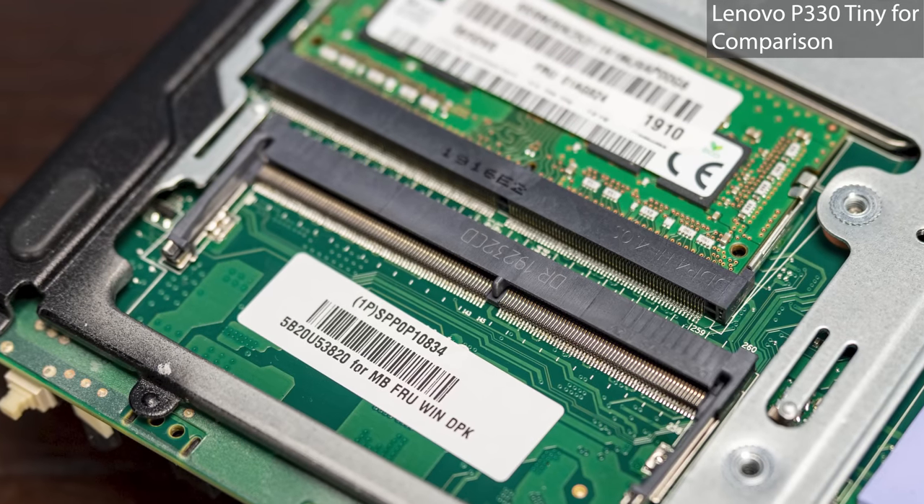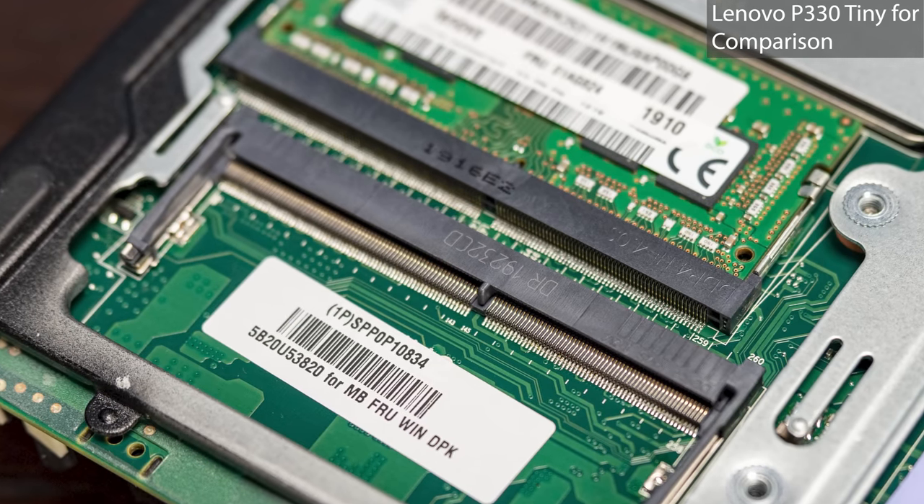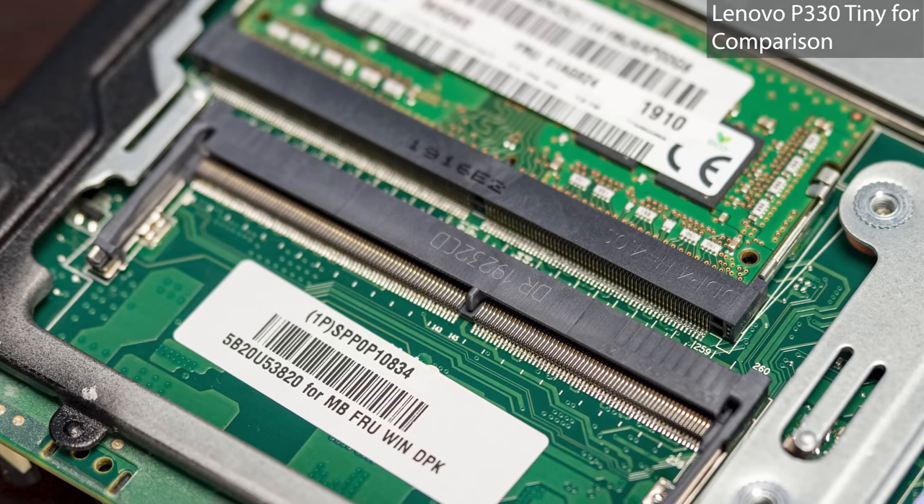While that side of the internals is easy to access and has a lot of expandability, the other side frankly does not. We have soldered-on 4GB of memory — you cannot expand it, there's no SO-DIMM slot, and you're just stuck with four gigs. Lenovo may offer higher memory configurations, but the big issue is that if you want more, you can't upgrade. We couldn't even run a lot of our benchmarks with that four gigabytes. Compare this to Project Tiny Mini Micro nodes, which have two SO-DIMM slots and can go up to 64GB on an 8th-gen Intel Core system — that is a real reason to choose Tiny Mini Micro over something like this.